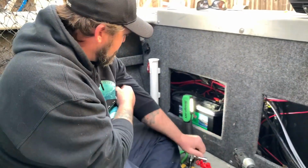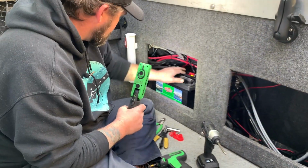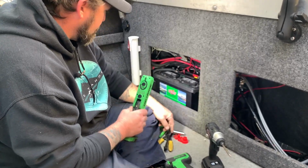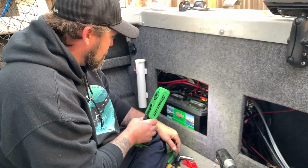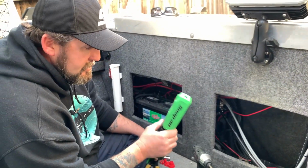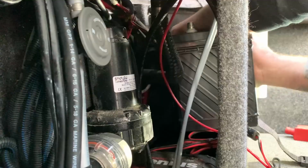I mean, that's pretty much it there for the crank battery. Just hooking it all back up. Yeah. You just added one, right? Basically. Yeah, that wire, the charge wire, and then the negative wire coming off of the isolator, going to that battery, and then we're running the second battery wire over to the second battery. Now we'll install that second battery.